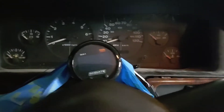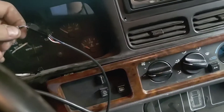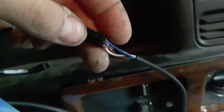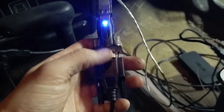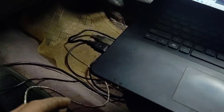I've got an Innovate in this Jeep, and to my knowledge, as long as you have a serial out, any wideband can do this. I'm not exactly sure — I just know from my experience of what I did today. This has a serial out and it comes with this cable to serial, and then I just used a serial to USB adapter I got at Best Buy, and a USB cable right into the computer. And this is my HP Tuners plugged right in. Goat Rope Garage had a USB hub so he had both plugged into a hub and then one cable going in.